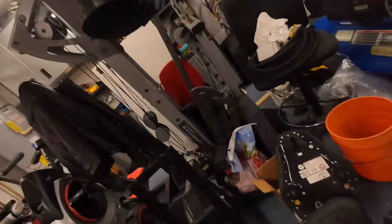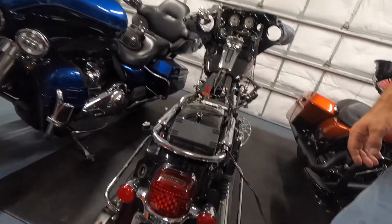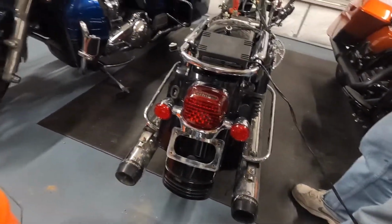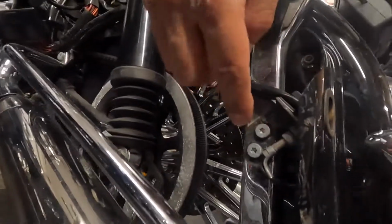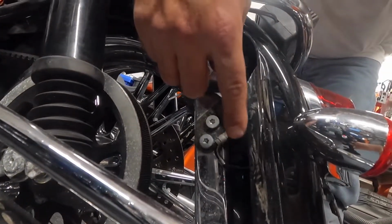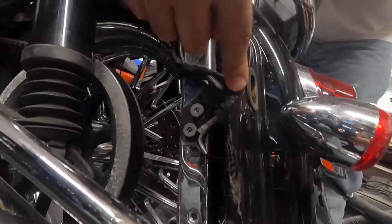The rear fender actually doesn't look to have sustained a lot in the way of damage. A little bit of scuffing over here. I don't know if I can get that or not, but there's a little bit of scuffing on the fender extension, but that's plastic. It's not metal. It's not going to rust. It's all going to get sanded down, with flex agent in the plastics so that the paint doesn't crack. We're going to do all that stuff, and I'm going to paint it myself.